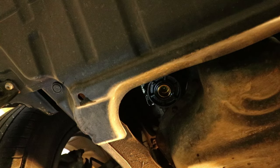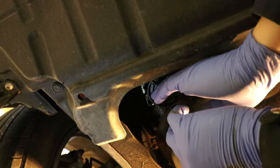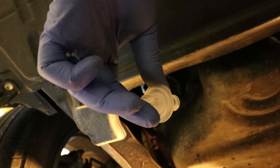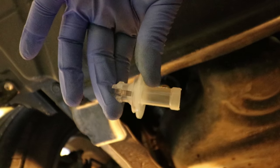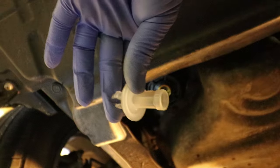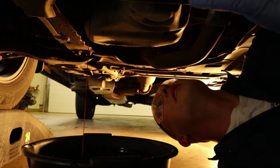A little bit of oil came out — not a lot. This came off all as one piece. There's actually an O-ring up in here still, so I'm going to get a little pick and pull it out too, because you need to replace that. Next up is our little spigot adapter. We're going to push this up into the filter housing into this brass opening. Once you push it through, a gush of oil is going to come out. Just be ready for the oil to come flowing out into your pan. While that's draining out, there's really not much to do — maybe go grab lunch.